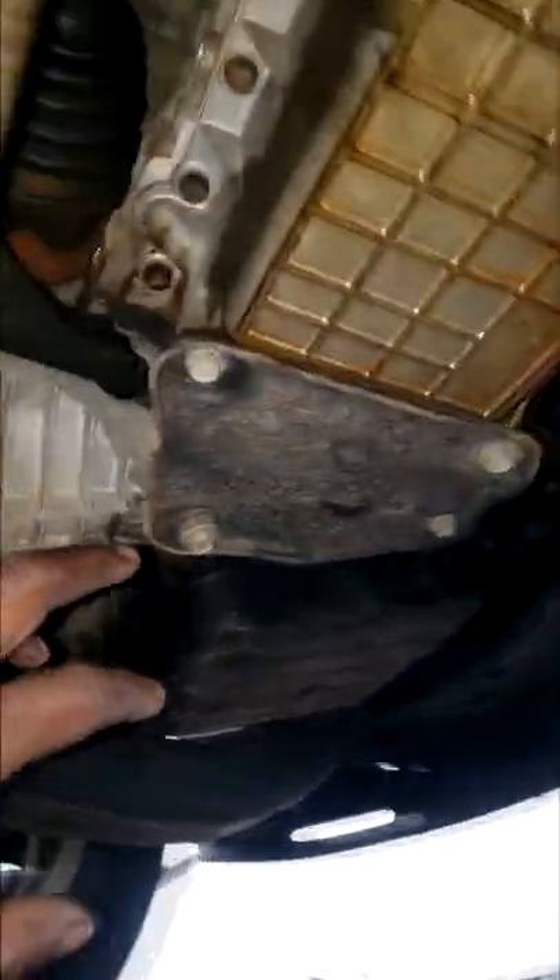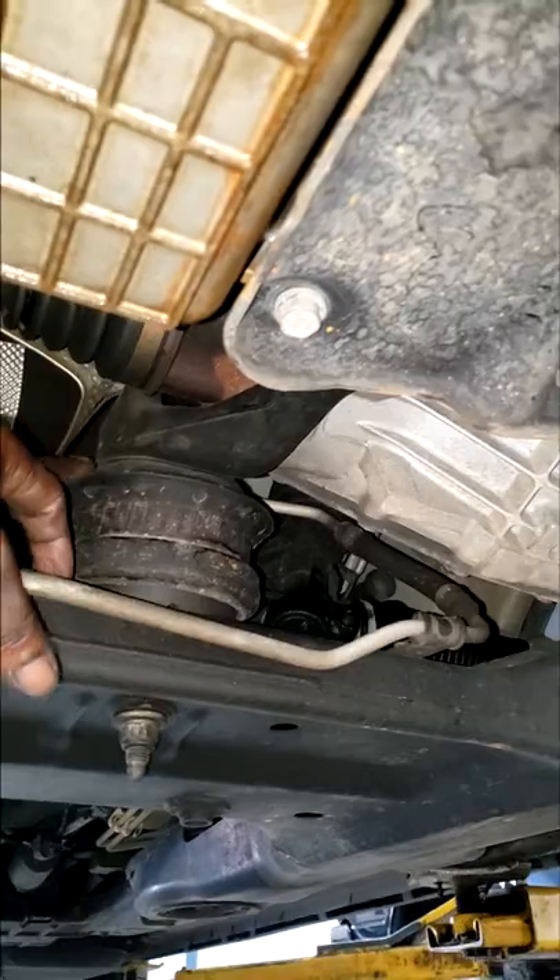Alright guys, I have it up in the air. This is that Pacifica that bangs in and out of gear. They said he just had some suspension work done — I can see these are brand new control arms, yes, both sides. But where is that suspension noise? Big clunking noise. Feel like a motor mount. I don't know if they had the motor mounts replaced.